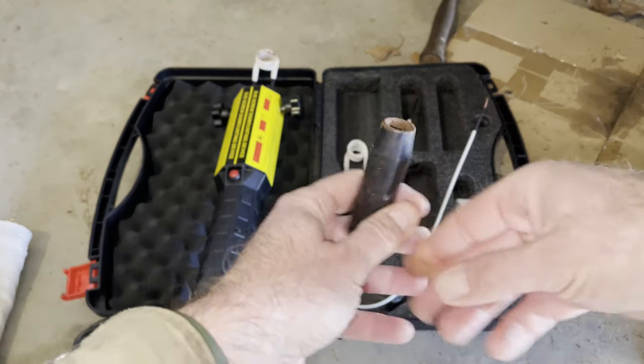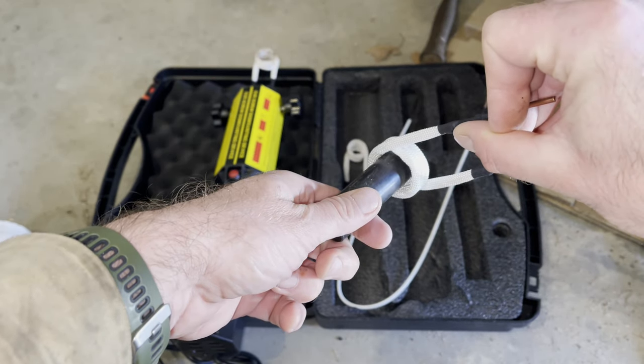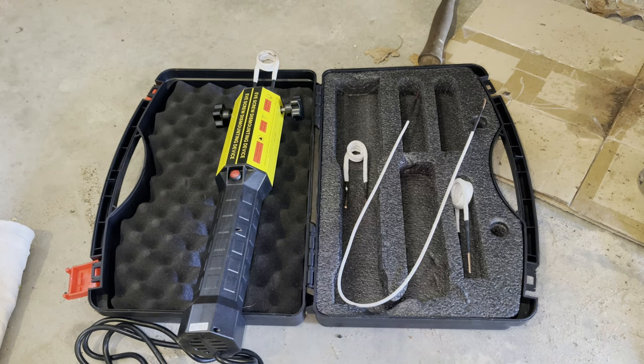Although this is a socket, the idea is that you stick it over the bolt that you want to warm up and then it will heat it up. I will tell you it actually works pretty good. Right now I'm replacing a lower control arm on my truck. I took it to have an alignment done and the guy said he couldn't do one side because he couldn't get the alignment bolts free to make the adjustments. So I bought the tool thinking I would give it a try to see if it would free up the bolts without having to use an acetylene torch. I just removed one of them and I was pretty impressed, so I decided I'll make a video to show you just how easy this is.